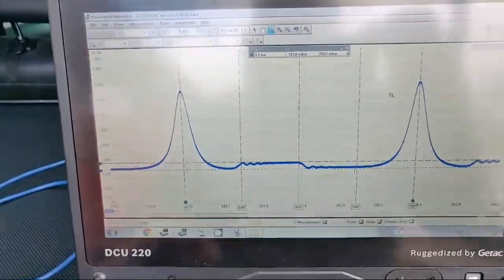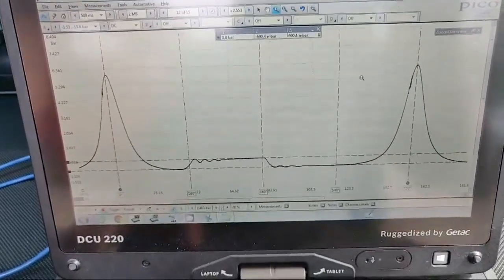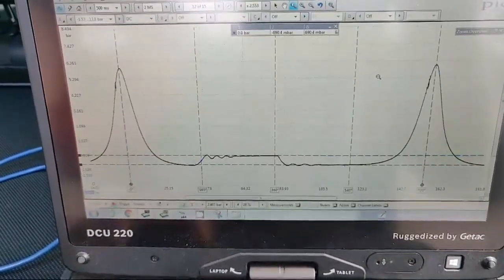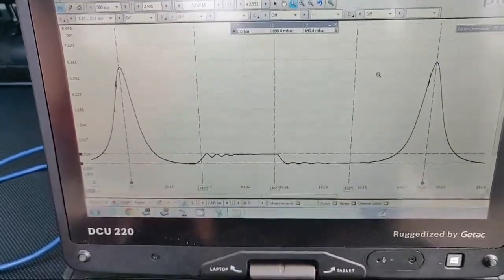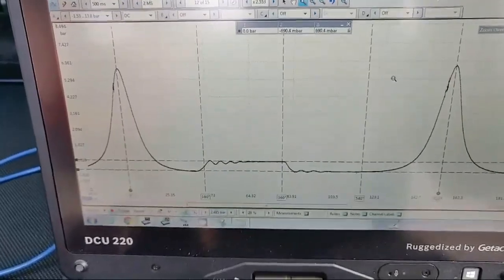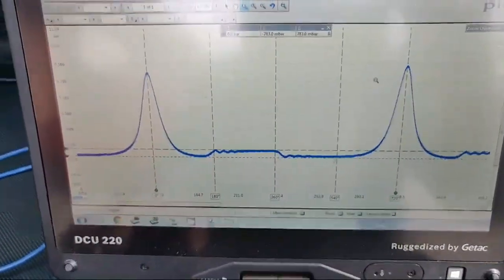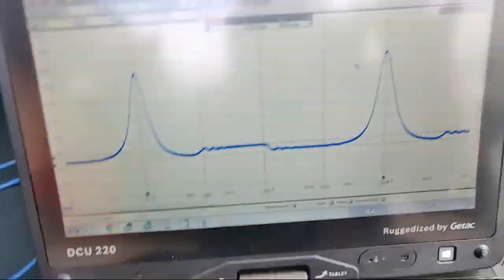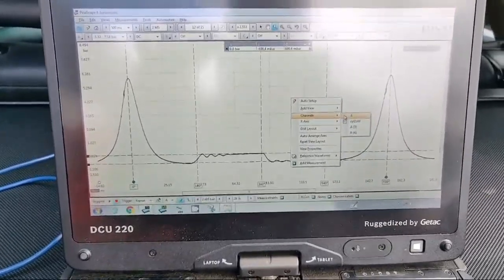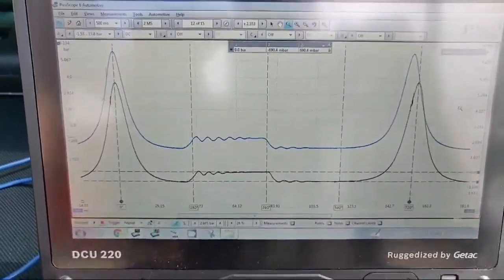So that's the replacement cam, original cam - you can quite clearly see there's a difference at the 180 and the 360-degree time marks. Whether it's cam profile or whatever, it's still got the original lifters in it, so the only variable there is the actual cam profile itself. It's running absolutely perfectly now - we've just got a cylinder one misfire. The black is cylinder two, and then cylinder one has the misfire. You can see the exhaust plateaus are a lot nicer on cylinder two than cylinder one.